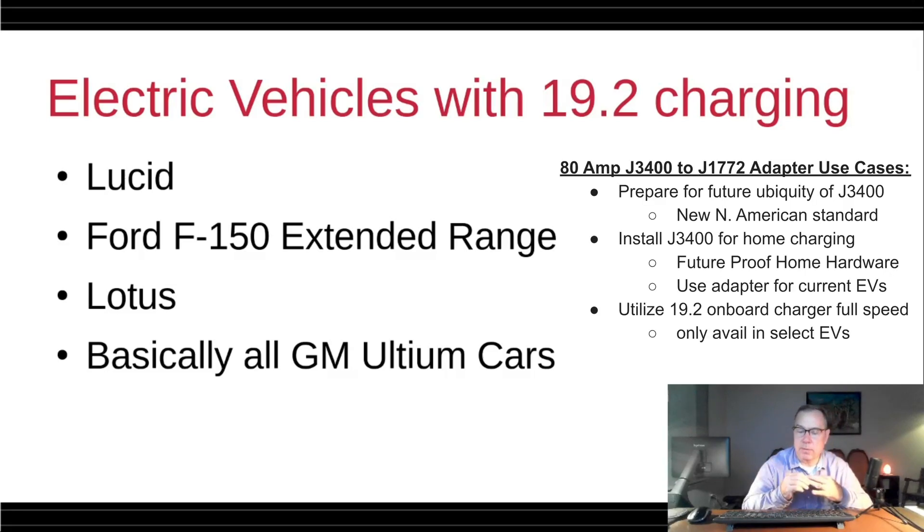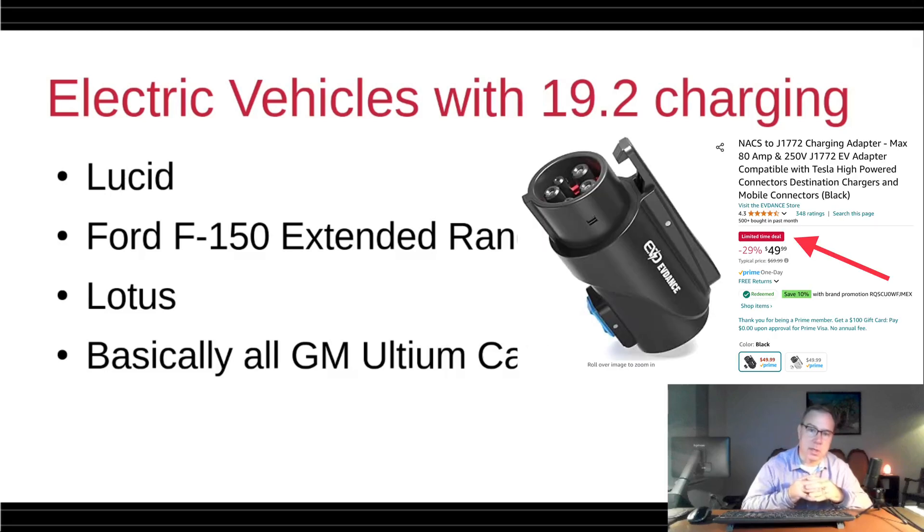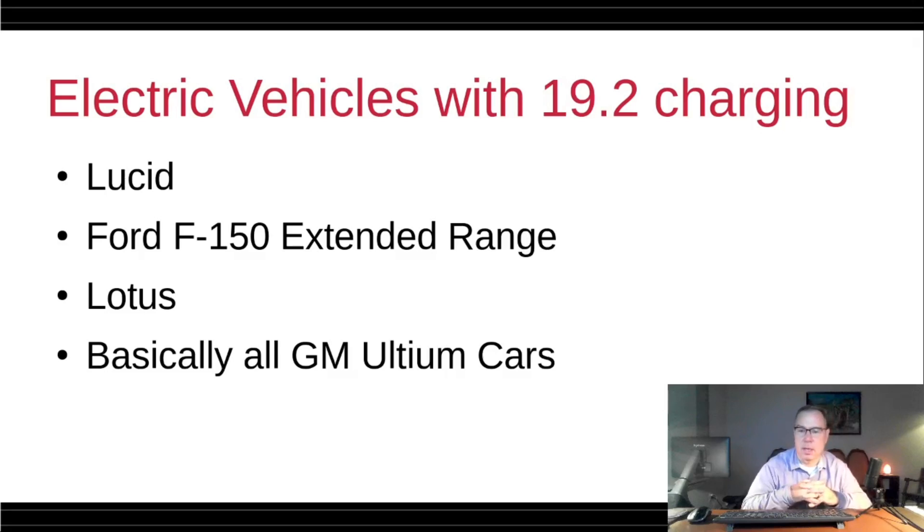To take full advantage of the 80-amp charger adapter, you need a Tesla source at 19.2 kilowatts, which is a little tricky to find, but as time goes on that should increase. If you're just looking to purchase a future-proofed adapter, it might make sense to do this. Right now it's priced very aggressively — $50 on Amazon — but using the discount code, which knocks 25% off the website price, brings it down to $48.75, which is actually better than the Amazon storefront price. That's a damn good price for an 80-amp adapter.